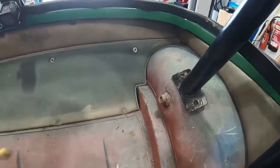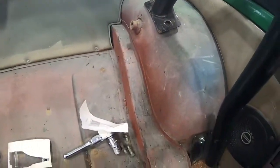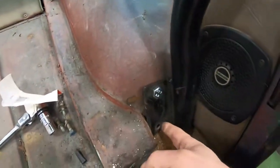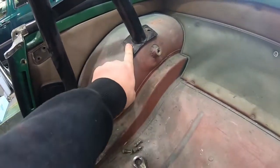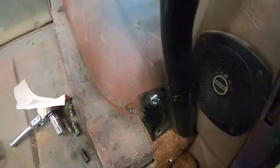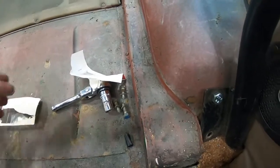So the roll bar will then be in. I can then try and knock these bits back where these plates are bent — whether it's through storage or transportation I don't know — same with the other one there. I'm not just going to go in with a bolt and a normal nut. I've got some big repair washers — big three millimetre thick repair washers. In the future I might put a big five mil metal plate behind it just to spread the load a little bit. I've also got some lock nuts to go on, but for the meantime I'll just use big washers and standard nuts just to hold it in place while I drill the rest of the holes.